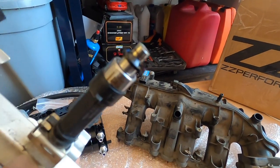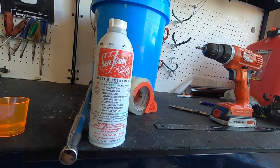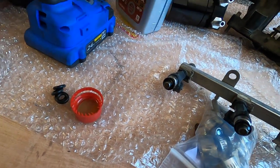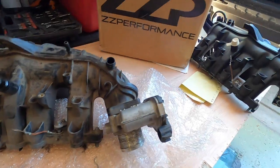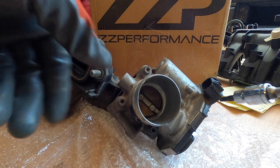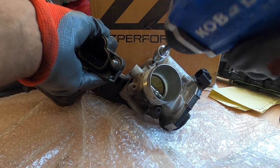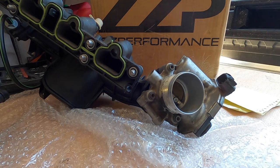I'm going to try to get the fuel injectors out with the fuel rail so the only o-rings to replace are the lower ones, which I also purchased from ZZP. I still had some fuel inside the fuel rail so I dumped that in a gas container. To take off the lower o-rings, use a pick tool to grab the o-ring and pull it off, make sure the injector surface is clean, then put the new ones on. I also cleaned the injectors by soaking them in a little shot glass of Sea Foam fuel injector cleaner — they cleaned out a whole bunch of gunk.